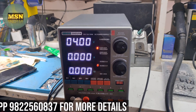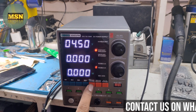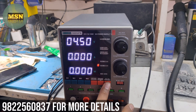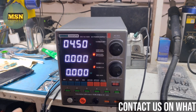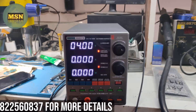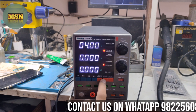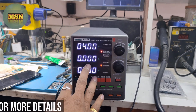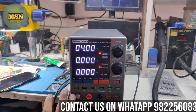M3 can have a reading set here and M4 can have a different reading. For this reason you can use over-current protection and over-voltage protection. If you have extra voltage going to the phone — for example M3 has more voltage, max 4.2V — and if you exceed that, it can damage the PCB. When connected with over-voltage and over-current protection enabled, it will trip and protect the board. This is a very good function.